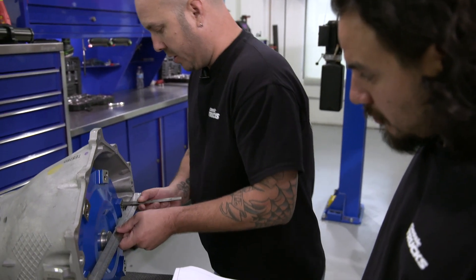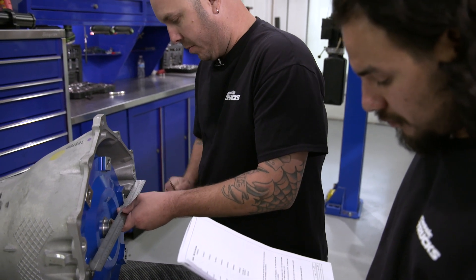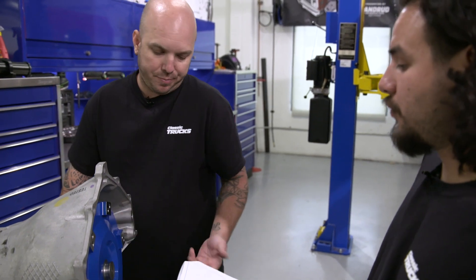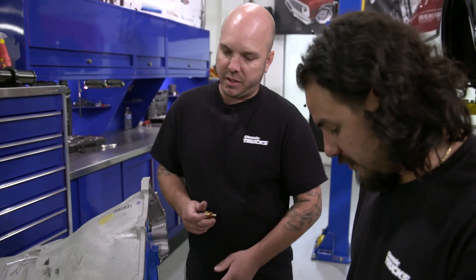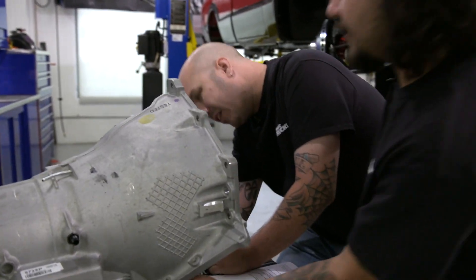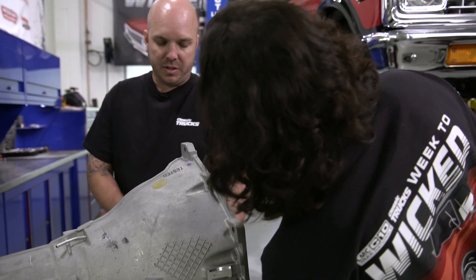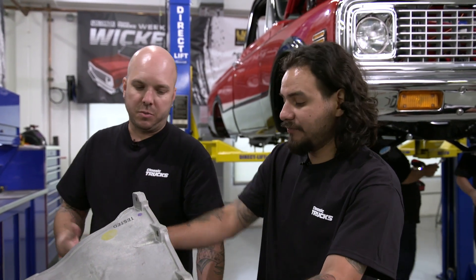Once it's in there, you gotta check it in there. Sometimes they'll give you a distance — which is seven-eighths. But they don't give you anything, so they check it against the flywheel or the flex plate. I put it in, I was turning it and it clunked twice. It feels like it's all the way in. I went through the back and felt it — you can kind of feel that it's seated in there. We'll check it when the flex plate mates up — it should be between an eighth inch and a quarter inch, because it's gonna come out a little bit. You just don't want it to come out too far.